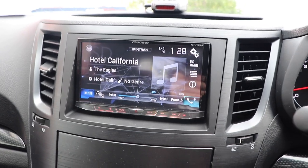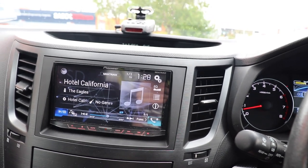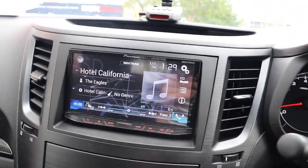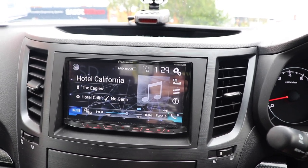So that's how the rear sensors are working, and yes, they are working independently, and I've got them in the right order. And with the front ones, they're just automatic, so if you just walk around in front of the car, they'll start going off and it will display on here. Something else you'll notice that was working is that relay I put in to tell the stereo to mute when it receives the mute trigger. That attenuation is working, so that's good, I'm happy with that.